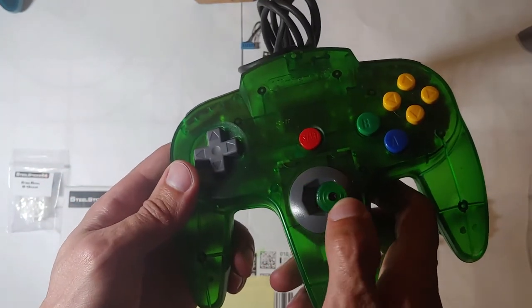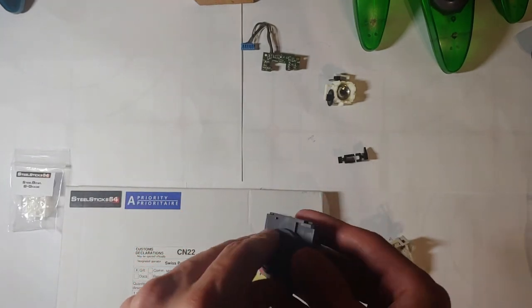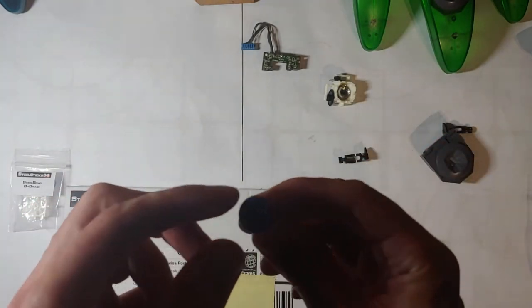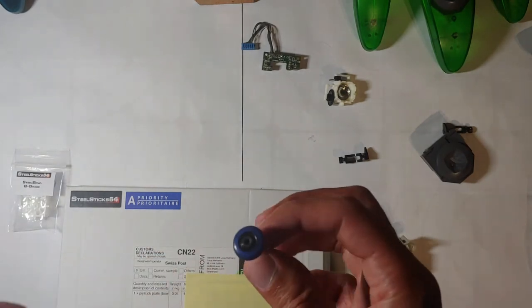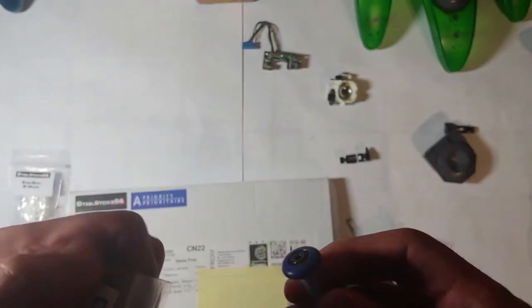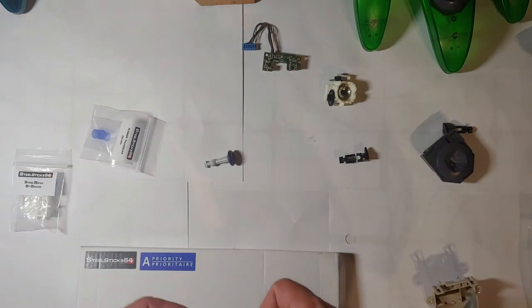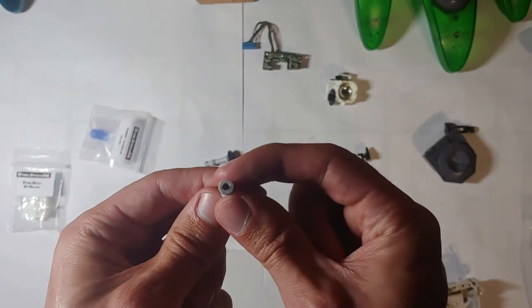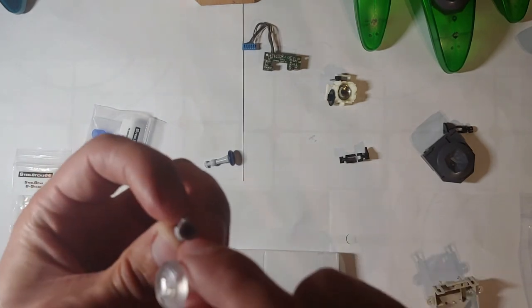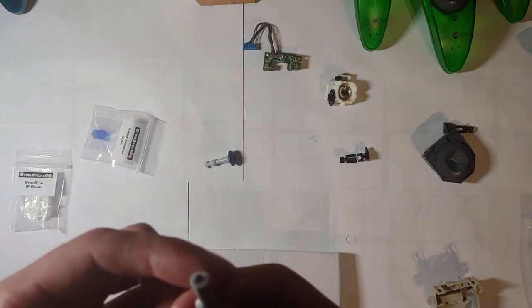For instance, the color matched green one. And take this one out. This one is a blue rubber with a black Delrin insert, and it's just screwed on there. And I'll show you how I did that. So it just screwed on there. What you do is you cut off the cap, you drill a hole, and you tap it. And then you just screw the cap on in.